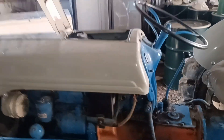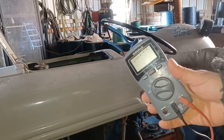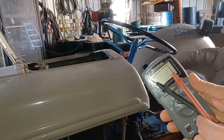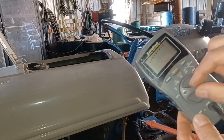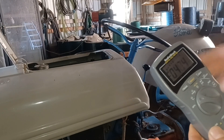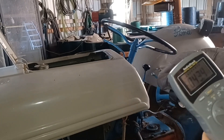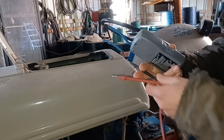I'm going to go grab a voltage tester and see where our battery is at for voltage when we crank. What we're using here is a digital volt-ohm meter — a digital multimeter with test leads. We're going to turn this to voltage. I'm going to put the black on the negative and the red on the positive. Hopefully I can do this and show you guys a reading on this.